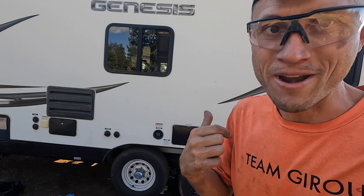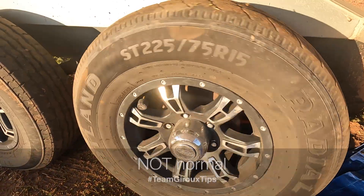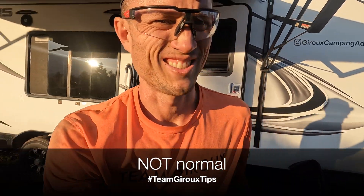I'm not winning right now, but I'm going to win and it's going to rock — stay tuned. One tire's lifted so I'm going to hook up, spin it, press brakes, and just test voltage and power. All four wheels spin freely but the front right one grinds a little bit more. Truck stops the trailer wheels — manual brake controller works, foot pedal works, no more trailer wiring fault.